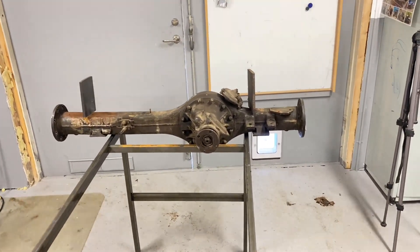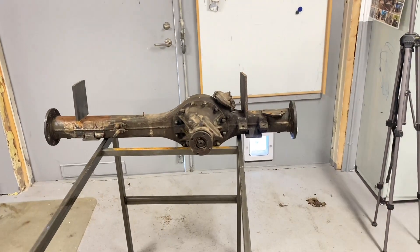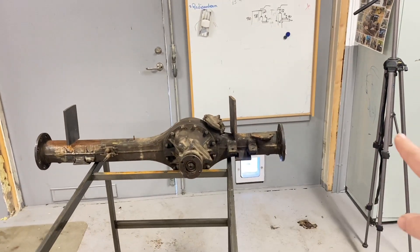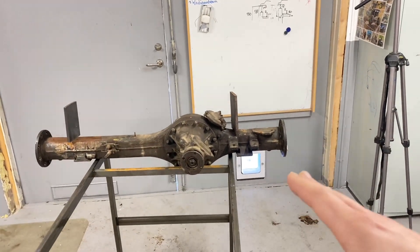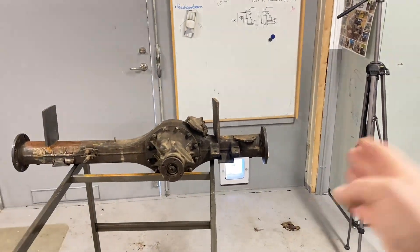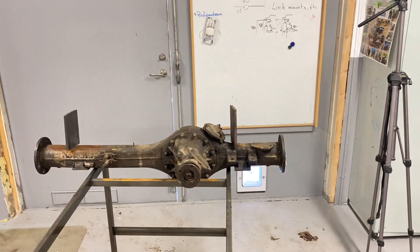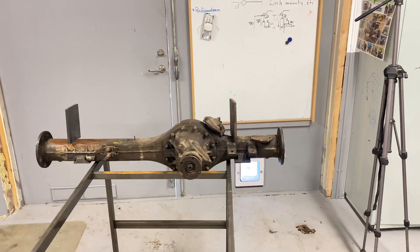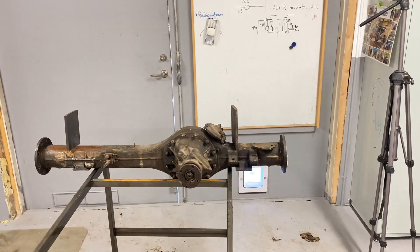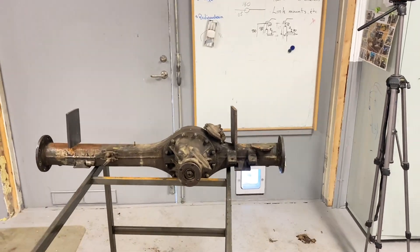I know this has been done by a guy in the US — he fitted these axles as-is on a TJ with a Dana 300 — but when I mocked these axles up under my TJ with the drivetrain still in the frame, there was no way it could be done. Either he offset the whole axle toward the right of the vehicle so the tire sticks out more to give clearance for the driveshaft, or he didn't have much up-travel. I think that thread was 10–15 years old on Pirate or Jeep Forums.